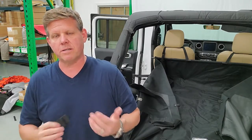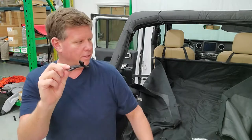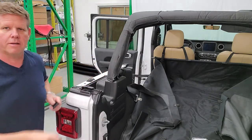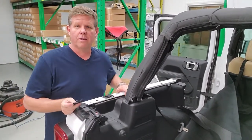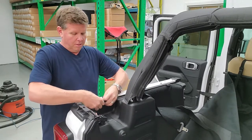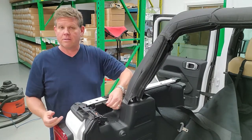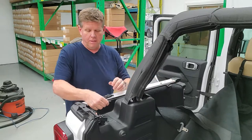For power top users, you don't have the bolt holes on top — they're underneath the window frame. We've included a slip lever in the package that fits underneath the ledge of the tub and in between the trim. Push it in so the flap is up, push it in as far as you can, then try to pull it out — and it holds in place. This also works on hard tops and soft tops anywhere you have trim, if you prefer not to use the bolts.